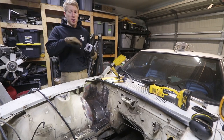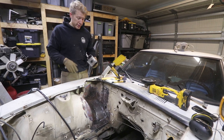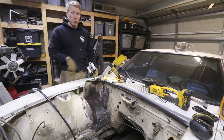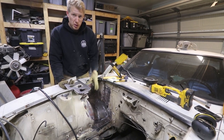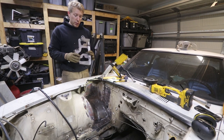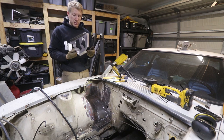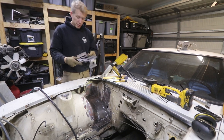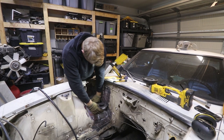I'm not going to worry too much about grinding all that down. I am going to clean up a little bit with the Dremel when I get some more pieces in - I don't have any pieces for it right now. I'll be able to get at all the areas I want to later, mostly down here in the corner where it meets the frame rail. I'll clean up those welds because those are going to be the most visible. All of this is going to get a skim coat of seam sealer as well, so we don't have to worry about water getting in there. Now I just broke this piece out - this is the Z Car Depot piece that they make. It's all laser cut and they just bend it up. Fitment could be better, definitely, but that's usually how it is with replacement panels like this - it's going to need quite a bit of massaging to get it in here.